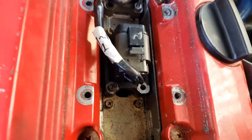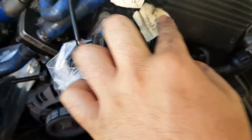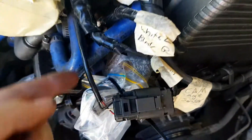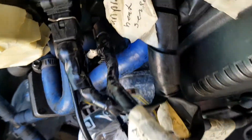Alright, so just a quick overview of all the wiring. So it's ignition coil 2, 1, 2, 3, and 4. I'm going to come down here — cam angle sensor, and this one, intake plug. That just goes in there, and then out of the wiring harness here, that goes in there. And that one goes down into a little plug there.